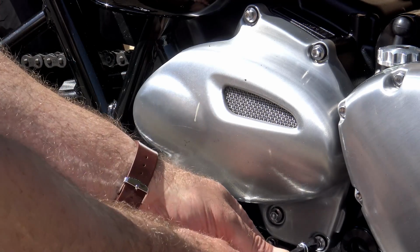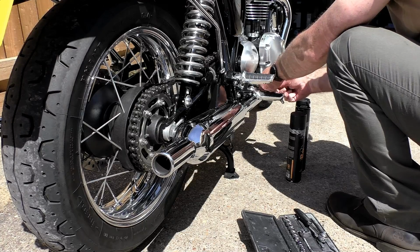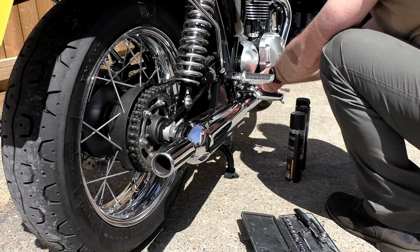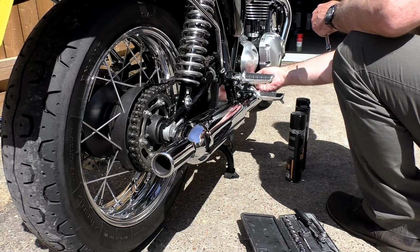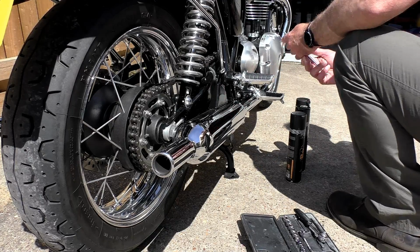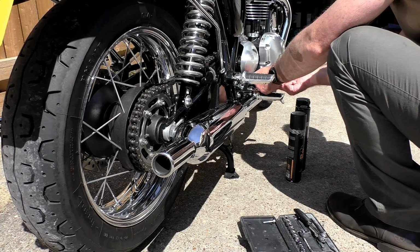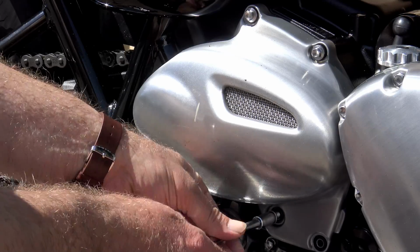And I think it may be something to do with the engine running very hot due to that catalytic converter, and some of the lube actually getting exposed to that heat and evaporating prematurely. Now, the only problem with this is that you're putting twice as much lube onto the chain as you used to have to do with conventional chain driven bikes, and this for me has created a couple of problems.